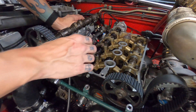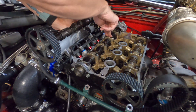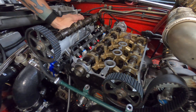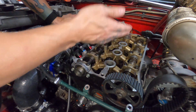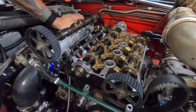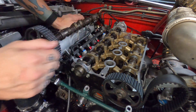The cam is installed. When you tighten it, you want to start on 3, 5, 1, 4, and 2. I did 150 inch-pounds on my torque wrench — this has been calibrated. I checked it against the cam bolts and slowly stepped it up until it matched. I found discrepancies online: one source said 21 foot-pounds, which is way too much. Everywhere else said 100 to 125 inch-pounds, so I figured 150 inch-pounds was a good compromise, and it feels great.